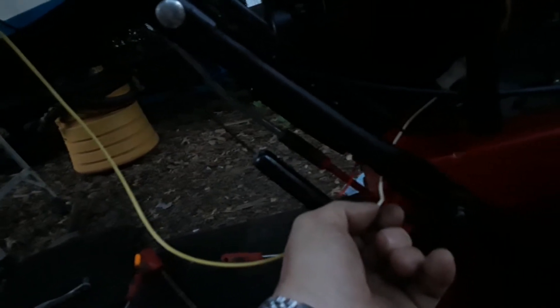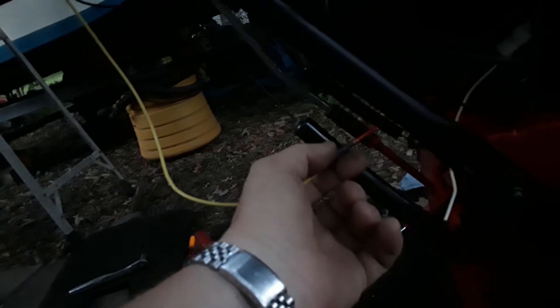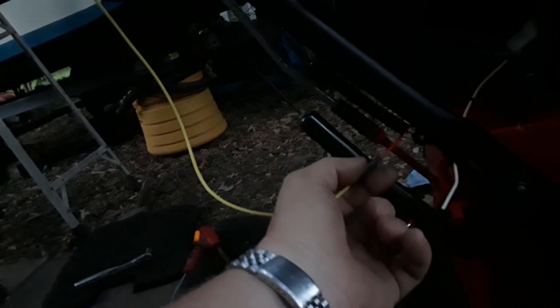You still have this much juice on the AC side that isn't even being tapped into. If you've got a snowblower where you have a battery you need to power, or a motor that runs your chute, you would hook your LED into the AC side which has 5 amps. So you could use your direct current to power your battery, run your motors, and all that stuff. But since the majority of snowblowers don't have that stuff, you just get that bigger, more powerful stator, run right into direct current, and then you're ready to go.